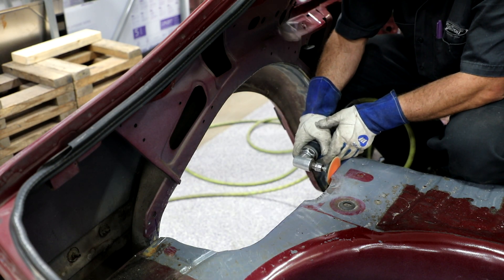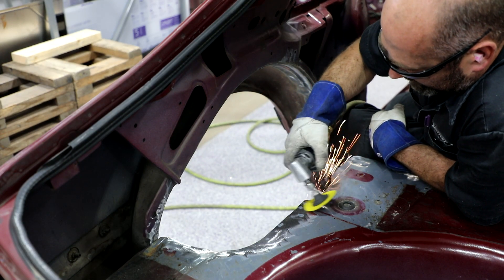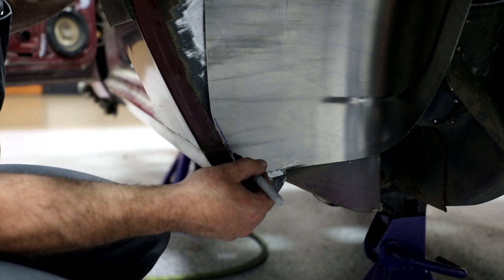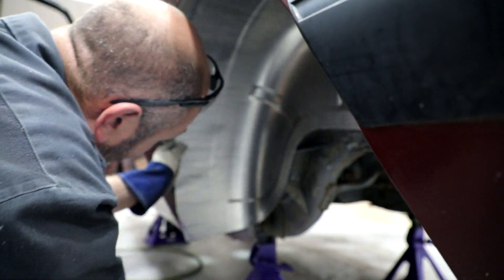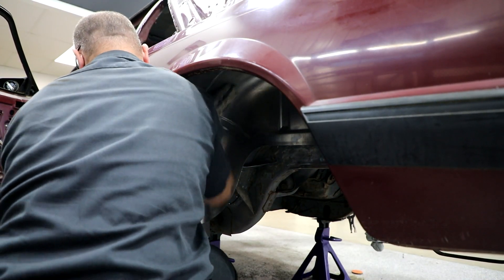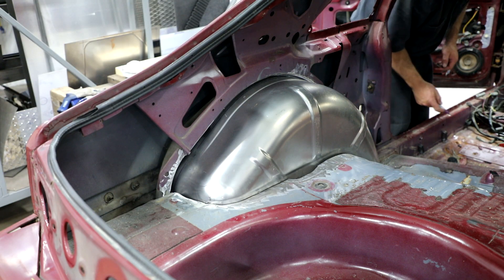Make sure all of the inner wheel tub is removed. Test fit the mini tub into the vehicle. You will need to trim the front corner of the mini tub for proper fitment, as the mini tub is wider than it needs to be in case they are being installed past the frame rail. Reposition the mini tub back into the vehicle so that the stamped feature sits evenly with the trunk floor. Keep the inside wall of the mini tub perpendicular to the trunk floor as possible. Make a reference line along the top arc of the mini tub using the outer wheel tub structure as a guide.